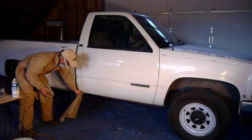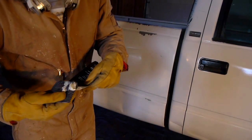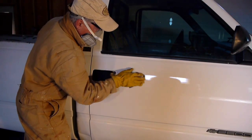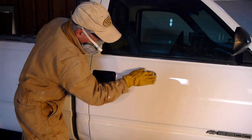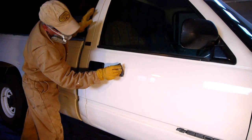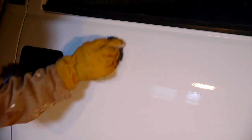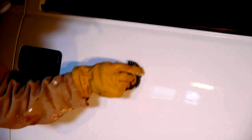And lastly, polish with the rubbing compound. The rubbing compound is used to polish and shine the clear coat. Squirt a small amount of rubbing compound onto a clean, dry cotton cloth, such as a clean t-shirt. Rub the repaired area in circular motions until the surface is shiny. Do not use a dirty rag or any paper products. They will leave scratches and you won't get a smooth, glossy finish.